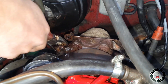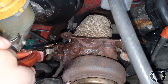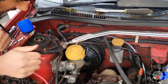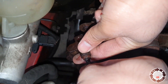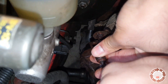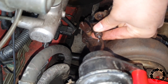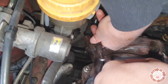Let's get the pin out now - the pin might be frozen. That's the little pin out, don't want to lose this. All you do is pop this up and just twist it in. So that's half a turn, one full turn - need to loosen that bolt a bit more. We've turned it once, going to turn it once more - so that's two full rotations. We're just going to use the spanner to nip this up.